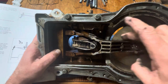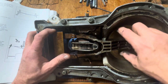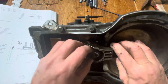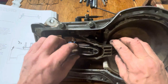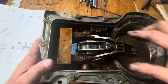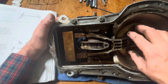If the plate is bent even a little, you will never get it straight. You could get a replacement plate and use a feeler gauge of 0.05 millimeters to reinstall it and do the adjustment — you can reuse the housing as long as the overall bearings and the mechanism for the 3-millimeter Allen screw are still working. You can take it all apart, clean it out, re-lubricate it, check and change bearings. The bearings sit on the side — there's an overhaul kit. I went the other route and just bought a good used unit with a known-good plate, I think for $50 or $75 off eBay.